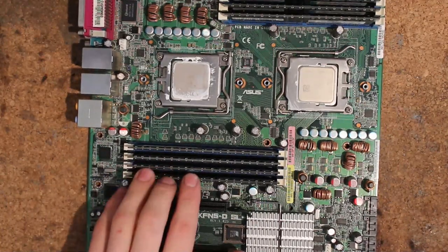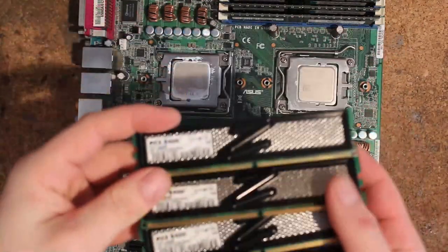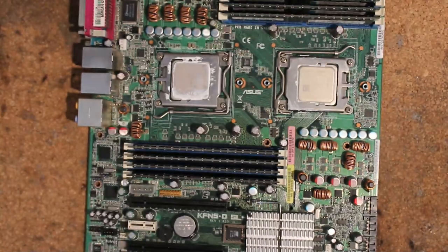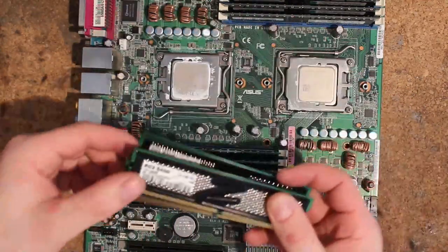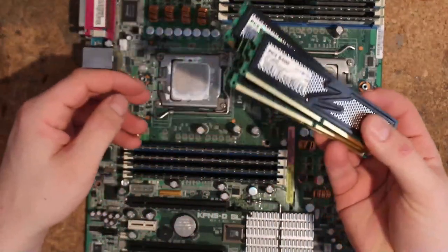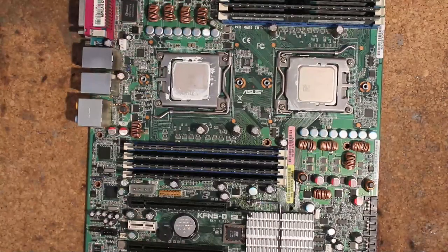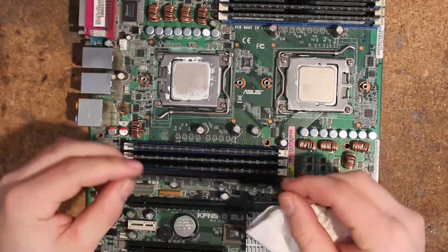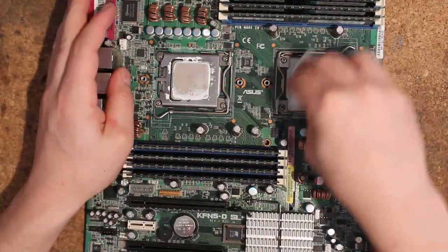Probably can sell the memory or something - actually probably not. It's not desktop memory, this stuff. This other memory here is what people want - that's obviously my own 16GB kit, in case any future competition has a use for 16GB on a DDR2 platform. It also doesn't clock well, but at least it's 800MHz and it runs on Intel, which is rather nice. But the stuff that came with the board is probably trash - I will find some good 800MHz DDR2 somewhere.